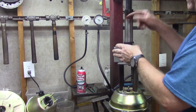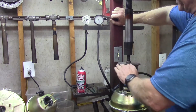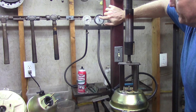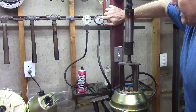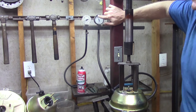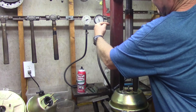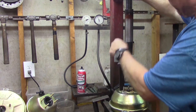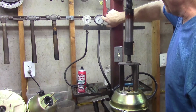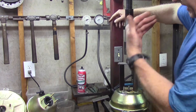Now we're going to step on the brakes and use some vacuum. There's a brake apply. We applied the brakes and we stopped. You notice that we used up some vacuum in the reservoir and the needle is staying stationary. That means the booster is doing exactly what it was supposed to be doing. If the poppet valve or the directional valve would mess up, we would see this vacuum drop off when we let off the brake. But when it stays stationary right there — that's what you're looking for. Textbook. You see it staying right there. That means it's not bleeding off.